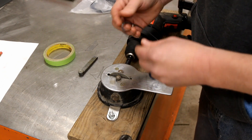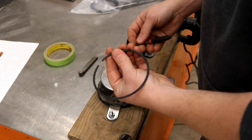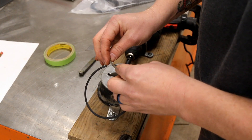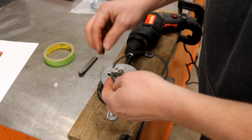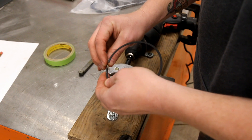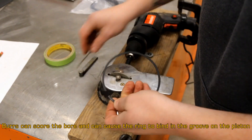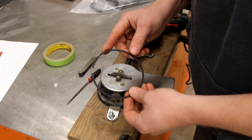We've ground a little bit. When I'm done grinding, before I test-fit I like to take this very small needle file and just very carefully run it down the edges and get the corners — just to make sure I don't have any burrs. Now we're going to check this back in the engine.